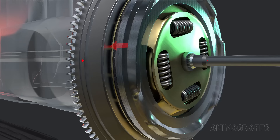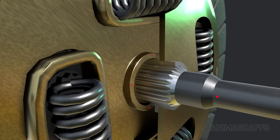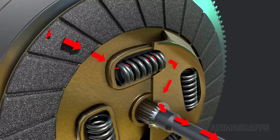To further ensure smooth power delivery, the clutch plate has a built-in damping system. The friction plate floats on the transmission input shaft. Power flows from the disc through damping springs, which push against a rotating top plate whose center is splined to the transmission input shaft. The springs continuously absorb vibrations or other potentially harmful anomalies in the flow of power.